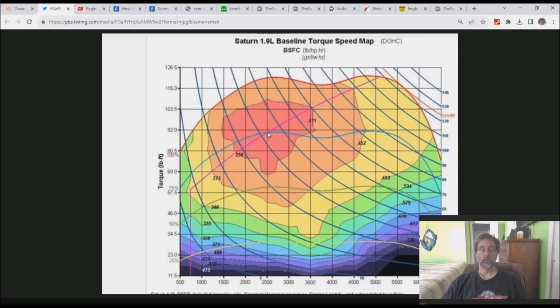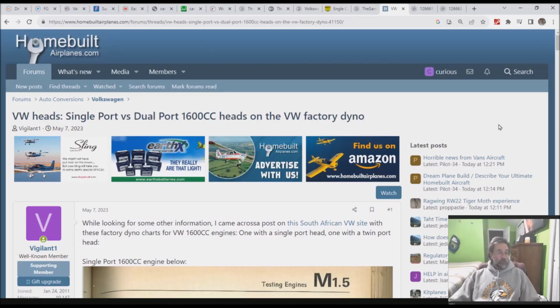That's also pretty much the case of my Kersey Miller camshaft. It's probably around 3,000 for a stocker. And you get into like the Engle W series, and they just kind of move from 3,000 up to 4,000, 4,500, and they just keep going. Well past what my channel's about. This area right in here, peak torque. This little bump over here on the Saturn motor is caused by a tuned port induction system. So that lump up there doesn't actually exist in something like a Volkswagen motor. So we just get this single bulge of peak torque, and we should be driving in the vicinity of peak torque. So the question is, well, what is peak torque for our motors?